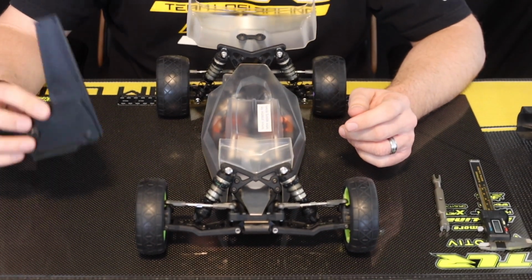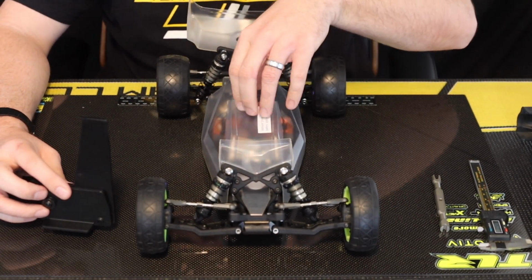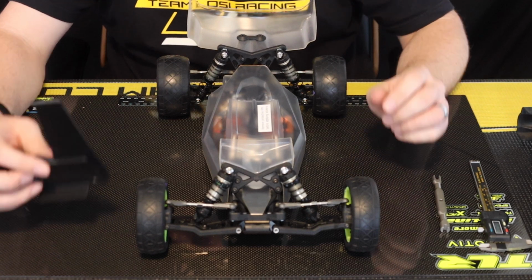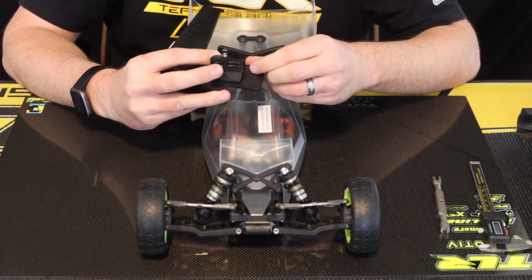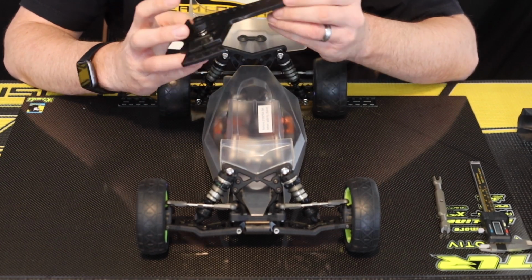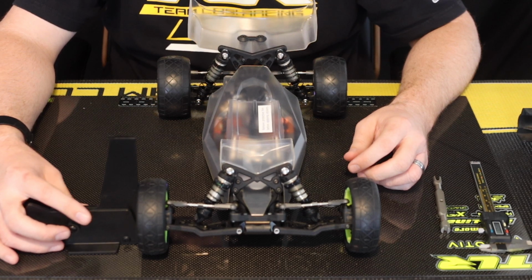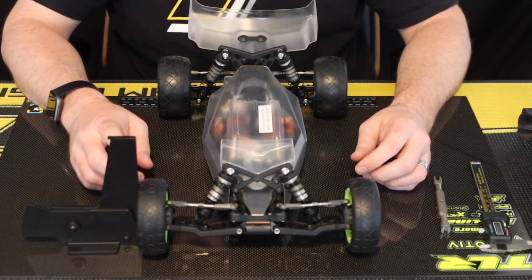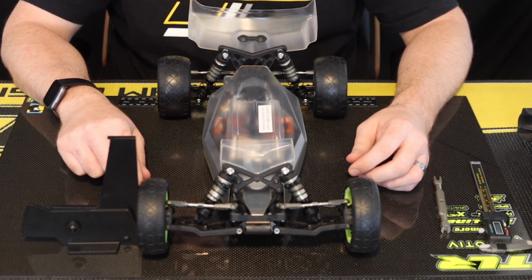but we're gonna go 1.5 today. So all you do is roll your car a little bit, push the suspension, and then set that camber gauge. I already set mine to 1.5 here. There's a mark for each degree, so it's just in between 1 and 2, negative. Go ahead and set that gauge next to the wheel here, and you wanna see no gap either at the top or the bottom. Right now we have a little bit of gap at the bottom.